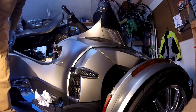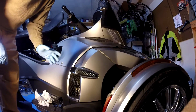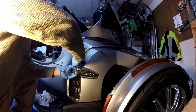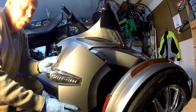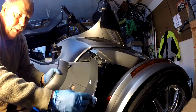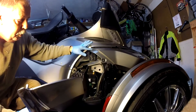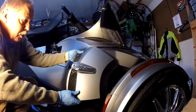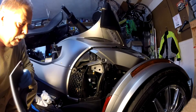The next step to get access to the oil filter is to remove the body panel along the side here. Watching videos of this, I was a little intimidated, but we're going to try to do it without breaking anything. Pulling back from the rear — I got the first body panel off. If you turn it around, there are four push pins: three are push pins and there's a clip. This is plastic so you don't want to break it. When removing the panel, don't pull straight out — pull the other push pins out and slide the top left corner back and it comes right out. First time I've ever done that and I didn't break anything.